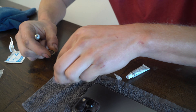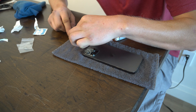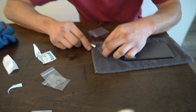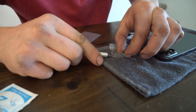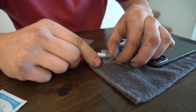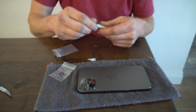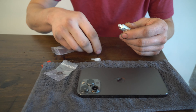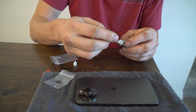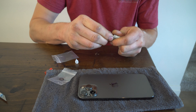You can choose what you want to do first. What you're supposed to do — try not to touch the inside of the lens, but you have to try and peel up that adhesive ring using this. If you're going to touch the inside, make sure it's the black area. What you have to do is lift this off — like that.